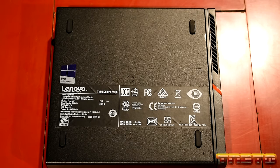Of course, before turning on a computer, you will want to get rid of this ISO alk. Because, you know, when you turn on a computer, what can happen? A little spark from the switch or whatever. So just to be safe, we'll get that ISO alk disposed of. We're done with it for now.